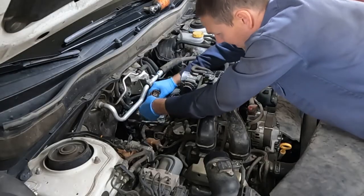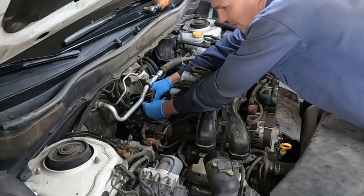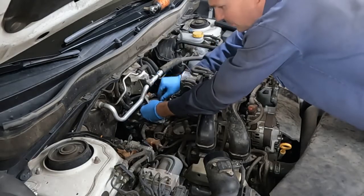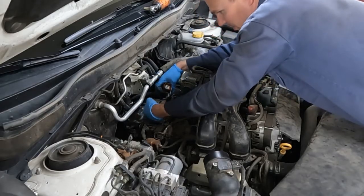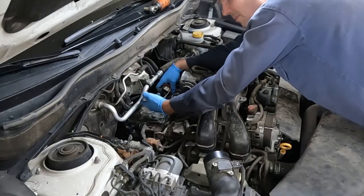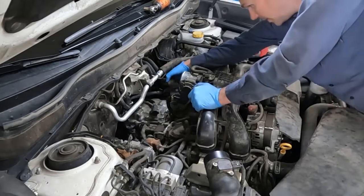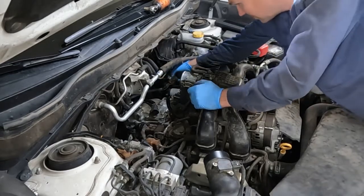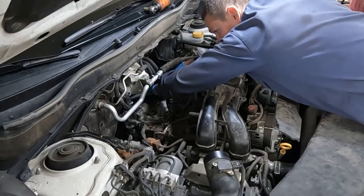We'll pull this bracket off. At the bottom, we'll want to pinch that connector with a pair of pliers or whatever — there's a little nub sticking out. We'll pinch that nub and push it through, and then that'll get our gray connector to separate from the bracket. The gray connector separated. If that little tab breaks, like on this one it broke — no big deal. Now the brown connector is just free. We can stuff it out of the way so it's not going to bother us.